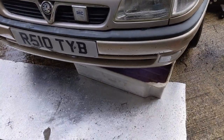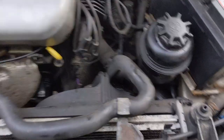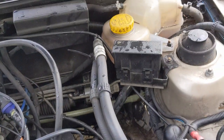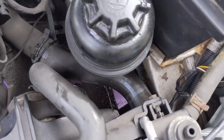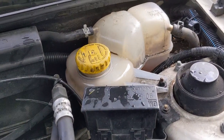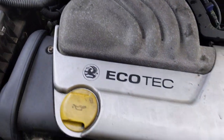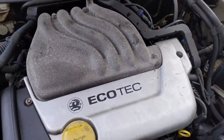So far all I did was drop the coolant out into the catch can down there, just from the centre pipe here. Flushed it through with fresh water, drained all that out, put that middle pipe back on, added the flush, and topped it all the way up with water. Now it's just a case of letting the engine run up to temperature and seeing what happens.